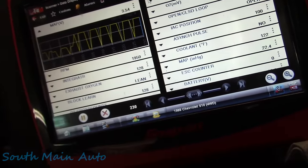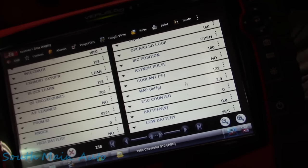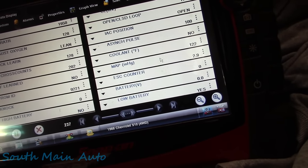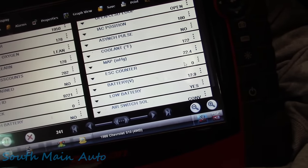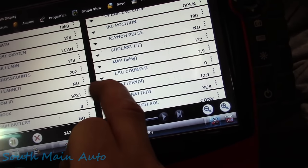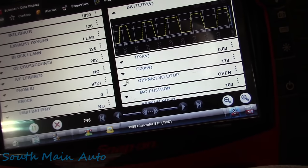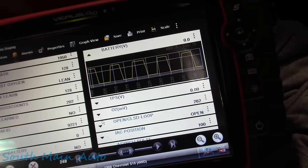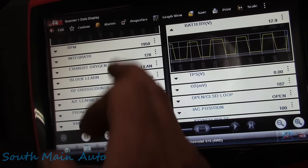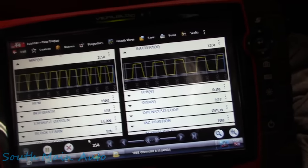Where's the coolant sensor sitting? All that stuff can be measured right at the PCM. Shows our battery voltage is zero, which is weird. Oh, now the battery's back to 12.9. So maybe that's also doing the zero thing. Yeah, it is. Okay. Gotcha. So this is all stuff that we can check, but definitely leaning on that bad PCM.